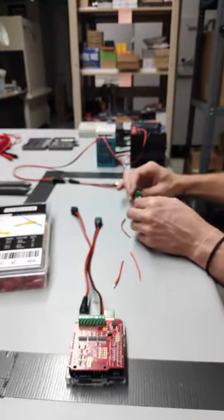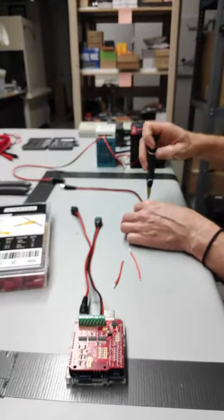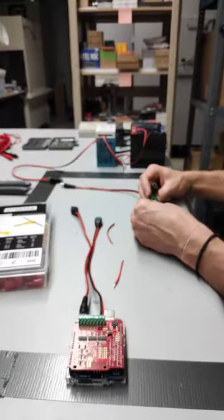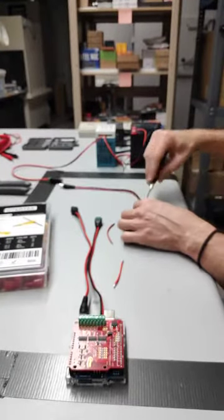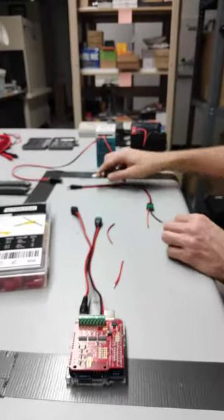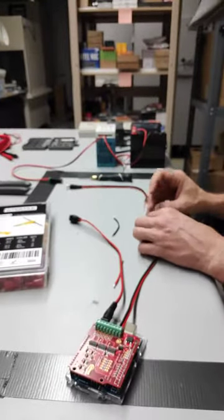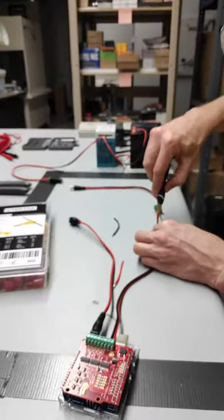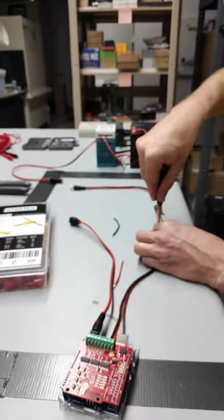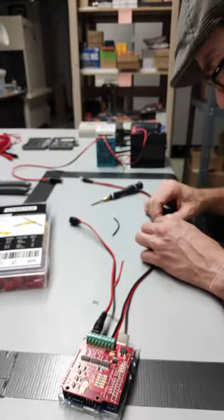What I'll do is go ahead and connect one line right here, connect that up to negative. And then I'm going to connect the positive to the positive. Now I effectively just have one coming out of each. Then what I'm going to do is hook this directly up on the side — we have a direct connection from 12 volts into the Infineon relay. And then I'll put a T-adapter right on these small wires.